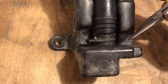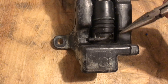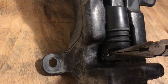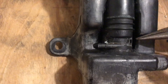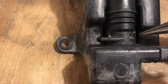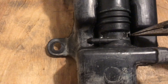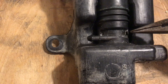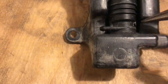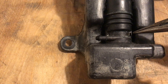So if you're having this issue, clean both surfaces really good. Make sure to stick that filter in and then put a really thick layer all around of black gasket maker and put it down. But before you do so, I would recommend sealing both sides of these little cracks on both sides with the same gasket maker. Clean that off really good and then seal it. I might have to completely redo this to get to this side — I'm probably going to try and shove the gasket maker all the way through, but it fixed it on this side and I just need to do it again on this side.